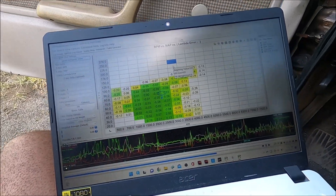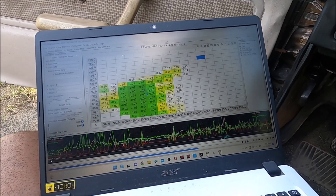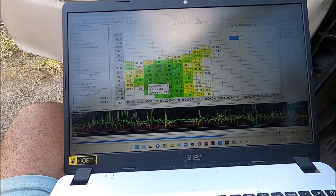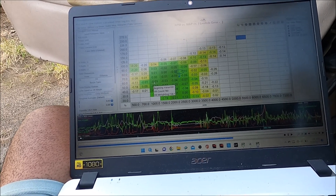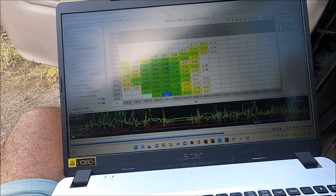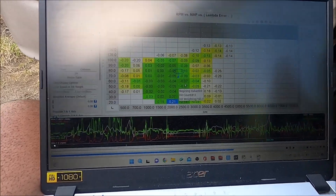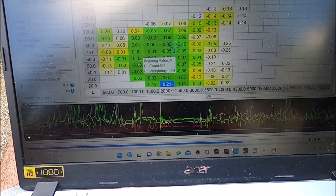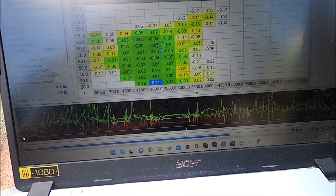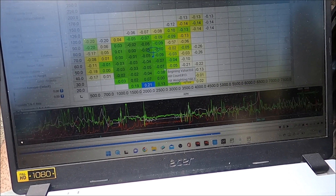Back, but not without incident — for some reason my fan stopped working; not sure if the relay or the fuse went out. I have a histogram pulled up showing how far off the tune is. Negative values mean the tune was that percent too rich. Everything was in open loop, no closed loop. For a base tune this is pretty good: in the mid-range cruising we're about 3% off; at 2000 RPM about 5% off; at 2500 about 7%; and at 1000-1500 we're around 2% off.